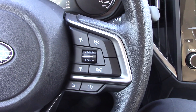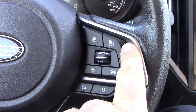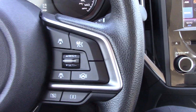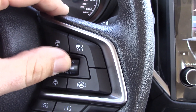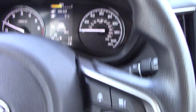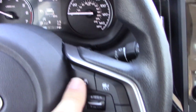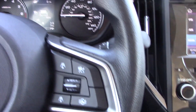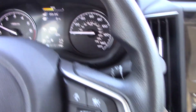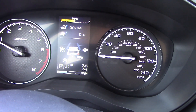So that is how the system should work. Just a brief overview of the adaptive cruise control itself. To turn it on, we push this button and now we know it's on because we get a little extra graphic there. To set your speed, bump that thing down. Once the speed is set, you can bump up or bump down to increase or decrease in five mile per hour increments. The following distance is controlled by these buttons — pushing one makes you closer to the car in front, and the other makes you further away. And then to turn on the new lane centering assist, we would push this button and then get that graphic there.